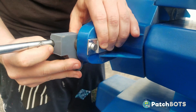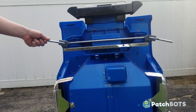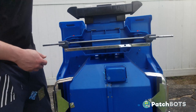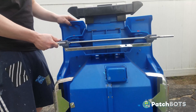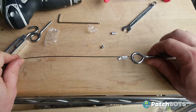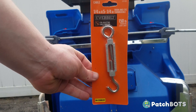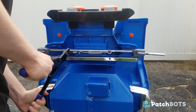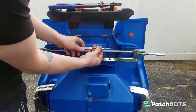After that is taken care of, we can reinstall our steering assembly by securing the two push nuts. At this point our steering assembly is really rigid and all of that extra wiggle and slop is gone, but as things begin to wear out from usage they may get loose again. So I'm going to install a turnbuckle between the two knuckles. My 3D print included holes to fit a cable through — this is a braking cable from a bicycle, which I looped around one end of a turnbuckle from Home Depot, fed that cable through the two knuckles, and crimped it off at the other end using some standard bike cable crimps.